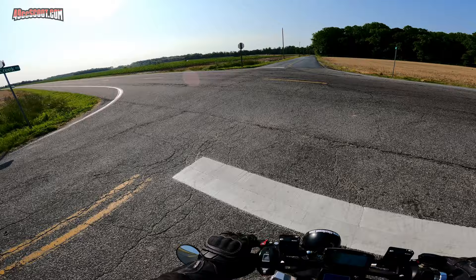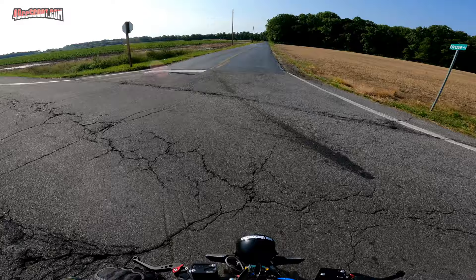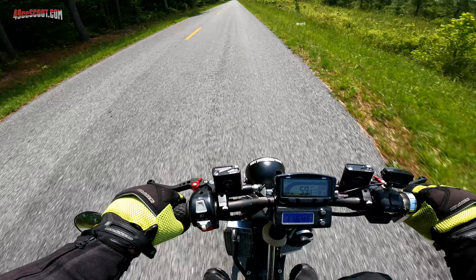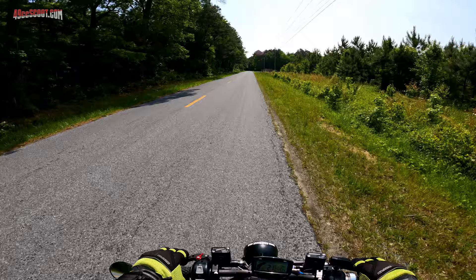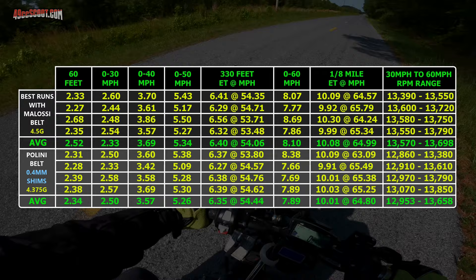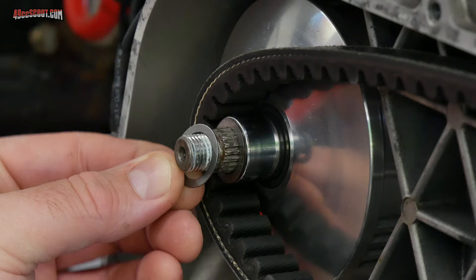Thanks to the change in low gear ratio, it felt sluggish as I first tried to leave a stop, then woke up quickly once I started moving — making it difficult for normal day-to-day riding. After a cool down I went out to do acceleration tests. It didn't feel much different than previous tests with the Molossi belt. The feeling wasn't quite the same off the line, but it seemed to pull well, and the weights that were a bit light before were actually working pretty well. Times were similar to my previous best runs, and RPM was peaking about where I'd want it. I then tried adding 0.5mm more shimming to total 0.9mm to see if I could improve takeoff belt position.